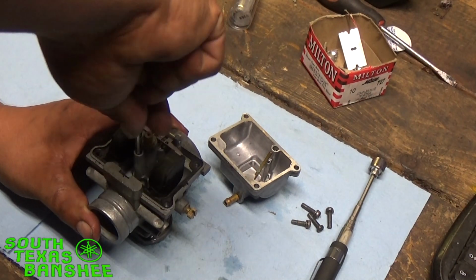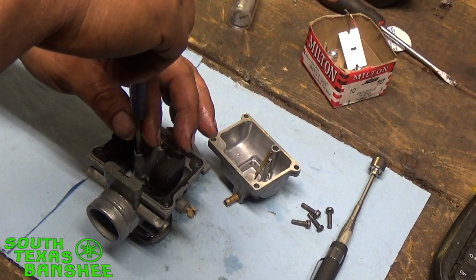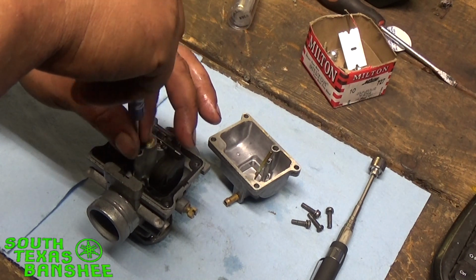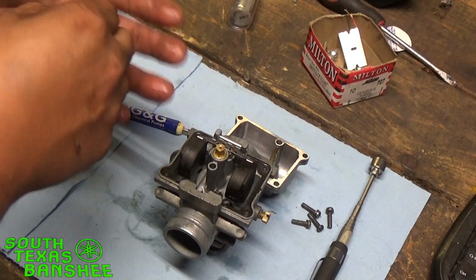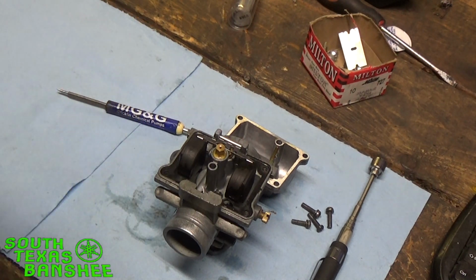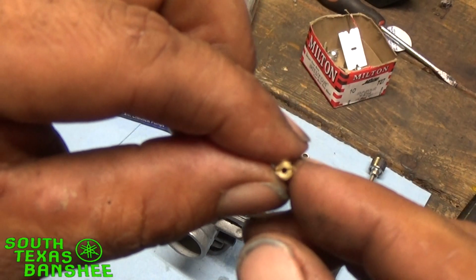So we'll reach in here. And I'm going to try not to disturb it too much, because if there's trash in there, I want to see it. I don't want to maybe dislodge the trash before I get it out. So it's screwed out. Dump the pilot out. Brand new pilot. And look at here. Where's my pen light at? Can't see it. But it is definitely plugged up.